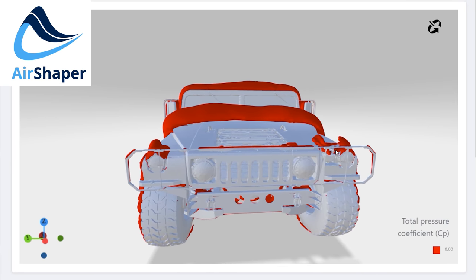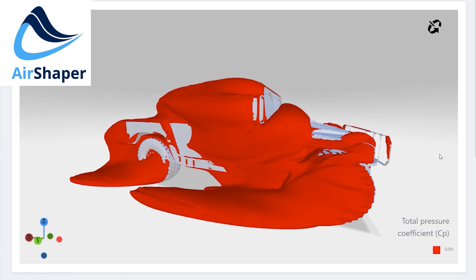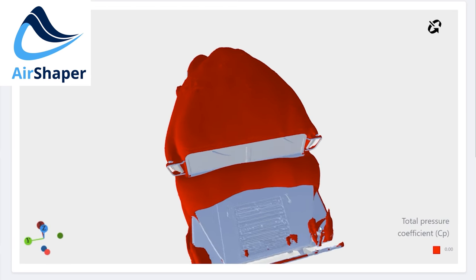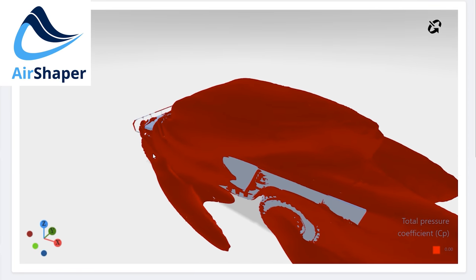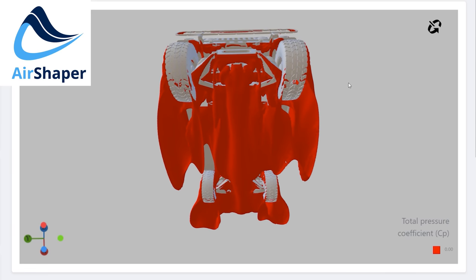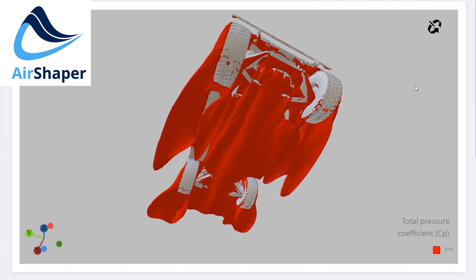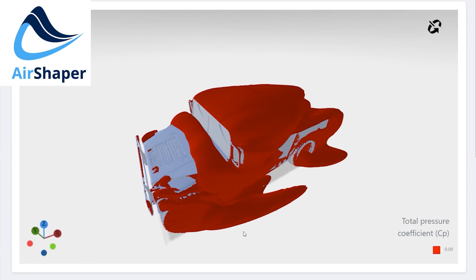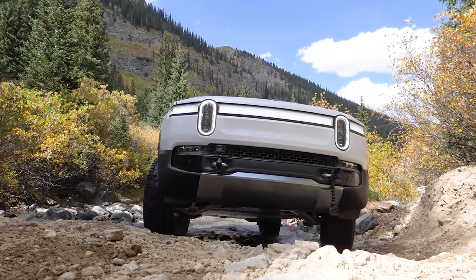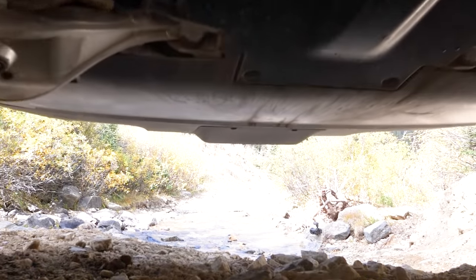All the red in the analysis represents friction from air or turbulence, meaning at high speeds — say 60 mph — the motor has to work very hard to push the Hummer forward since wind creates drag and works against us. Most of the power from the batteries at that speed will be used to overcome air resistance. There's a lot of drag from the exposed wheels in front and the exposed undercarriage. My Hummer has a drag coefficient of 0.82, which is extremely terrible — most regular cars have a drag coefficient of around 0.35.